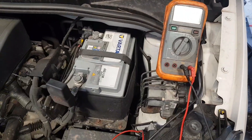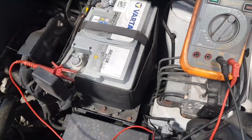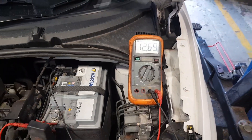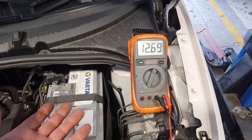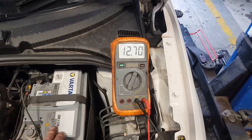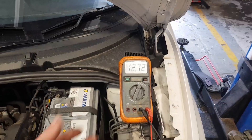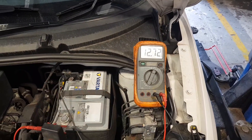So you could test your battery with a multimeter. Let's connect this up and switch it on — we've got 12.71 volts, 12.69 volts, so pretty good state of charge. But it doesn't really take into account anything else: internal resistance, the amount of amperage this battery can produce compared to its rated amperage. With the multimeter, we can test the volt drop while the engine is cranking.